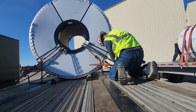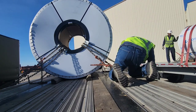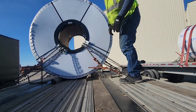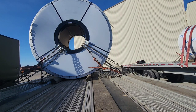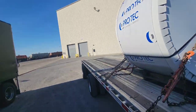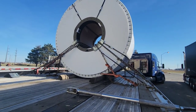I'm a little loose over there, so I want half an adjustment — doing it in the teardrop, not the binder. That was half a link — now I got bigger tension. If I had moved the binder it would have been a bigger adjustment. I'm going to get my bar, we'll tie this one up, do the same adjustment on the other side in the teardrop. All right — I'm coming to get you. Should be fine. We're going to climb up here again because we've got to tarp.